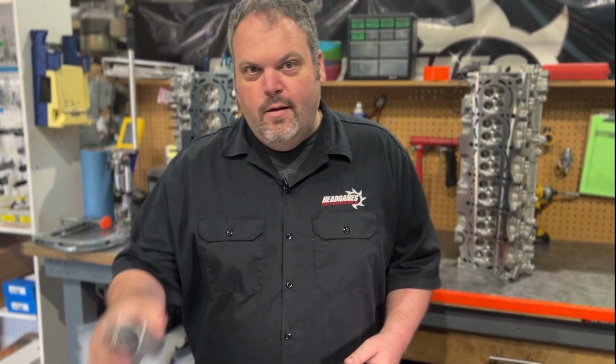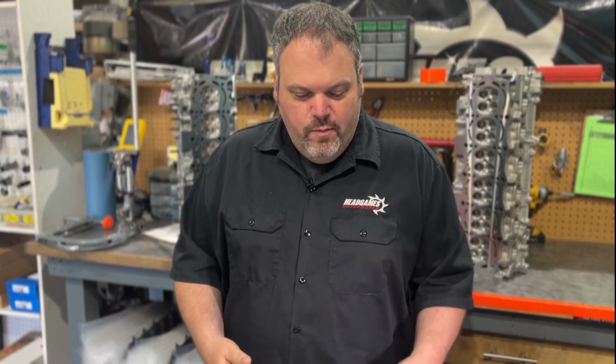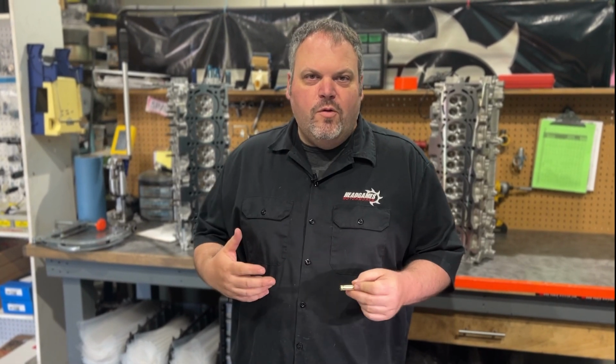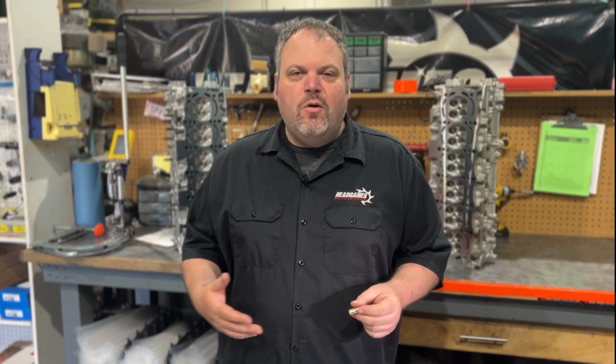All right, so we're gonna put a link somewhere because we actually have another video that is similar to this, but it goes more in depth on how we size it and how we install it, because you know, you got the air hammer and the driver and all that stuff. We're not gonna go over all that today. What we only wanted to make sure is that you understand that the outside diameter is much more important for install, because you can crack your cylinder head, than the inner diameter, because the inner diameter is something you're in a machine and you're going to size anyhow.